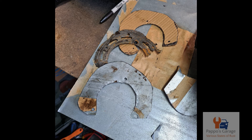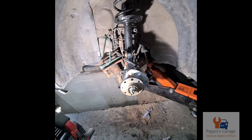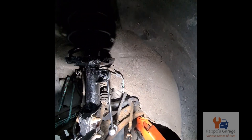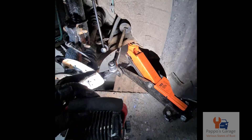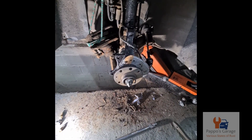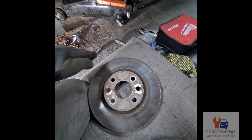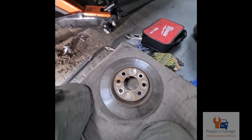Apologies for its rough look, but this is a piece of galvanised steel I've had knocking around the garage for years - I think it was part of the back boiler in the old house. This is the suspension now rebuilt. That's the heavy-duty drop link for the anti-roll bar, new track rod end, new flimsy bit of galvanised steel made up as a splash guard. Everything is now clean, so I'm going to put it back together.